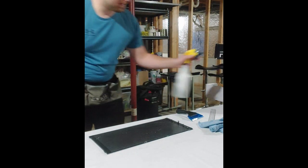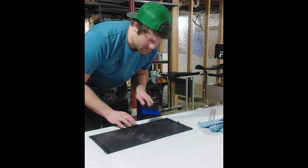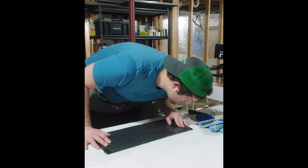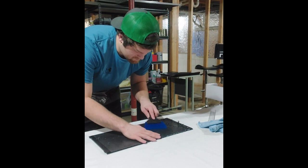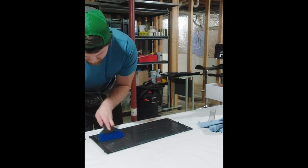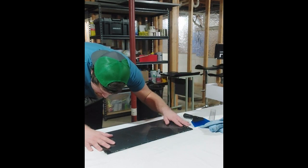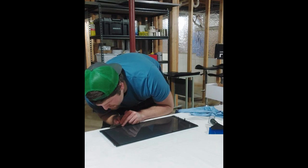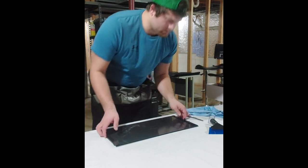Yeah, spray both sides again. Almost forgot. It's been a while. So the first time you squeegee through the center, it's going to kind of move around and walk around on you. Squeegee it kind of light so you can still move it. And then start moving it into position again. Lightly squeegee, so you're kind of tacking it down. Make sure it's right where you want it. Okay, just got one little imperfection here I'm going to fix, and that'll be it. That's that. That line's good. Alrighty.